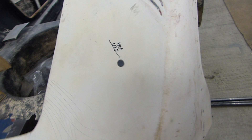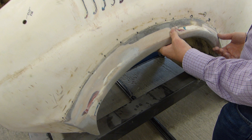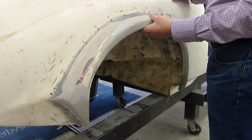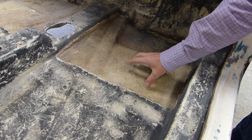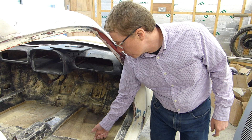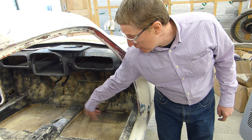We've got the same issue on this side with the wheel arch. This one is in better condition and probably the one we'd start working on first. You can see the later fixations, which are incorrect, and these are the correct early ones — absolutely superb. Those will be re-drilled, relocated, and the wheel arch put back to how it was originally. Moving inside, these floors have had a double skin. We suspect it may have had balsa wood in there because it's light and strong, but unfortunately balsa wood soaks in water, so we're going to get it back to original and re-skin it.